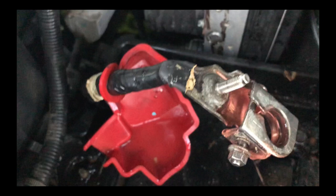Hopefully this video has been educational and you've learned something about the coke trick if you didn't already know it. It's good to just let the battery terminals sit in the coke — ten, twenty minutes. Basically let it sit until you can see bare copper, and then reattach them. Make sure you put some water on there to get the coke off so it doesn't get sticky. Reattach them, and then put your corrosion inhibitor on there — making sure the terminals are dry, so dab them off with a paper towel. Once you do that, they're good to go. As long as you've done your preventative maintenance, it'll save you a ton of money in the long run from having to spend money early, where you've ruined a perfectly good battery like I did.